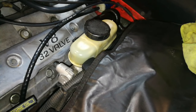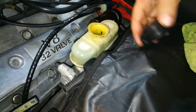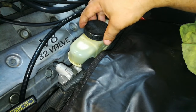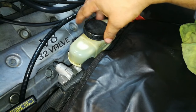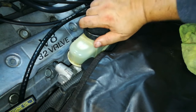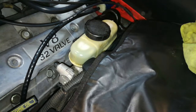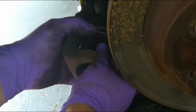I'm going to go ahead and compress the brake caliper. Anytime you're going to be compressing the brake caliper, you want to make sure that the brake reservoir cap is off and somewhat loose. You don't have to leave it off all the way — you just want to make sure that as the brake caliper is compressing, it doesn't have to fight any additional force. If you don't finish the job that night, make sure you tighten the cap so you keep any additional moisture from entering your brake system.